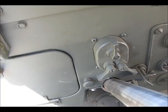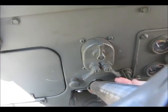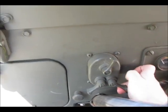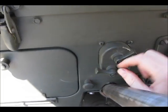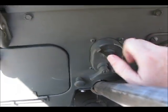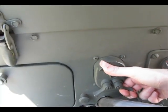Another unique feature of this vehicle — well, it's common in a lot of military vehicles but not the civilian market — is this really strange looking light switch control. By default, the vehicle doesn't have any brake lights when you turn it on and drive. You actually have to remember to set this to 'stop light' to just get the brake lights. When you want to drive at night, it's a good idea to set it to 'service drive' so you have headlights. You can also set the panel light to bright, dim, or off. At night it also has the option of driving with blackout lights, which I wouldn't recommend, but in the military it served a purpose to limit your visibility at night by using the minimal amount of light to drive with — not a good idea to try on the highway.